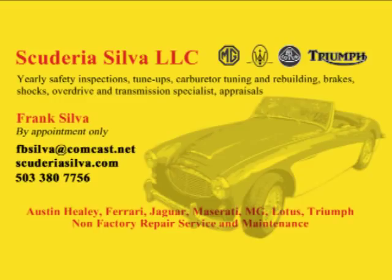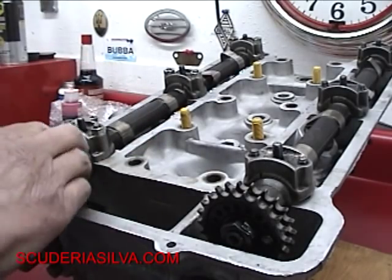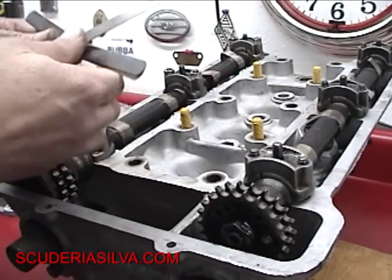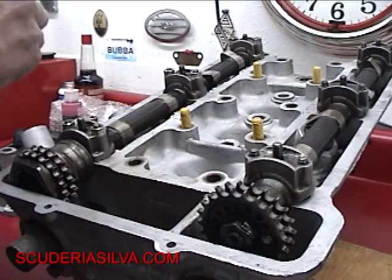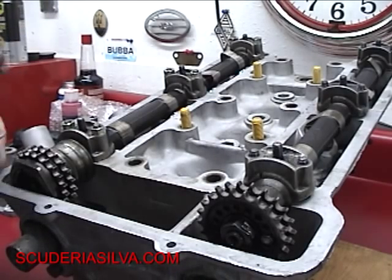Back at the laboratory, we're taking a few minutes here to do the intake camshaft installation on this wonderful little 2-liter. We want to adjust the valves right now. To adjust the valves, you install one camshaft only at a time.